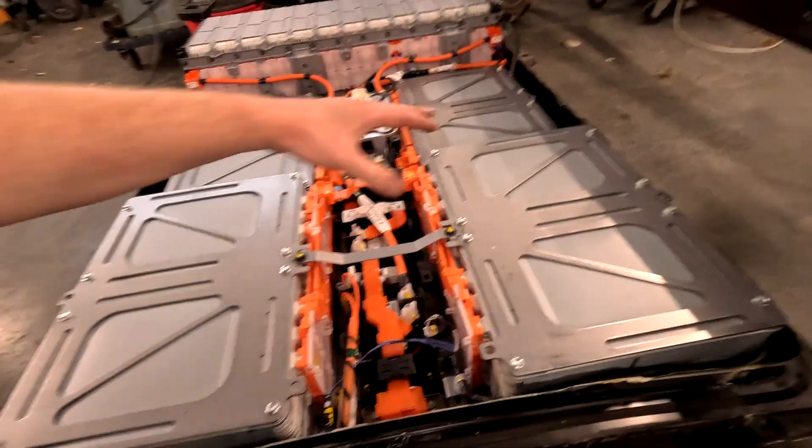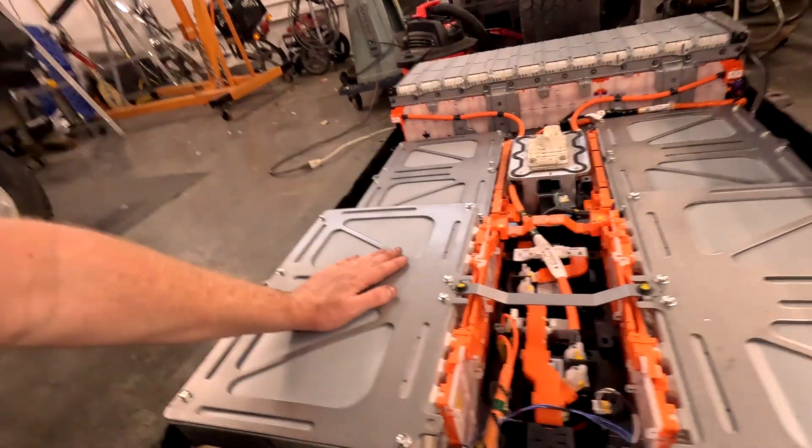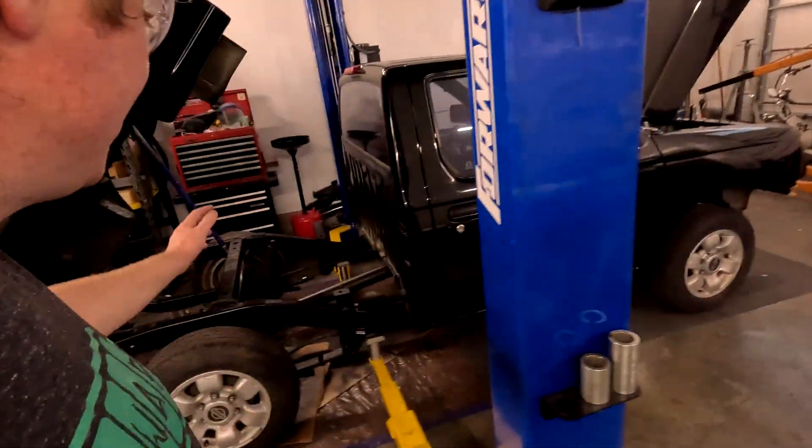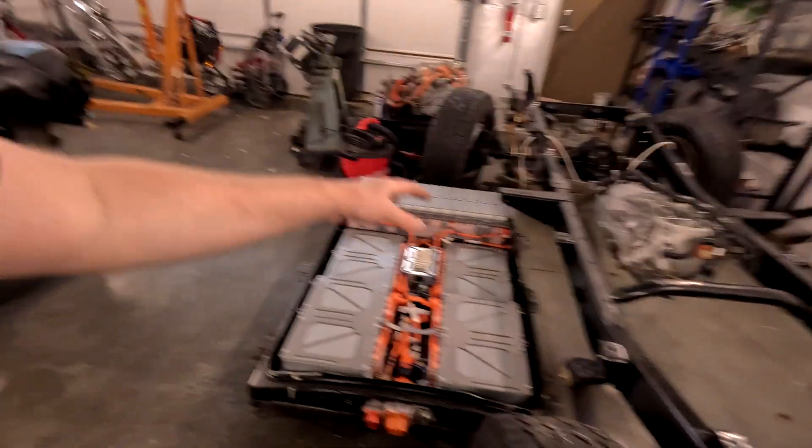Underneath each block of cells is a heating pad. The battery has temperature sensors, and when they drop below about minus 20 Celsius — which is pretty cold — those heaters turn on, drawing power from inside the pack to keep it from going below that threshold. All of this has to be transferred into the back of the Nissan pickup truck. That's the hardest part of this whole job. Fitting the battery into the vehicle is the hardest part of any EV conversion — not just physically fitting the batteries, but accounting for all the wiring, the BMS, the contactors, the service disconnect, and all the safety features.